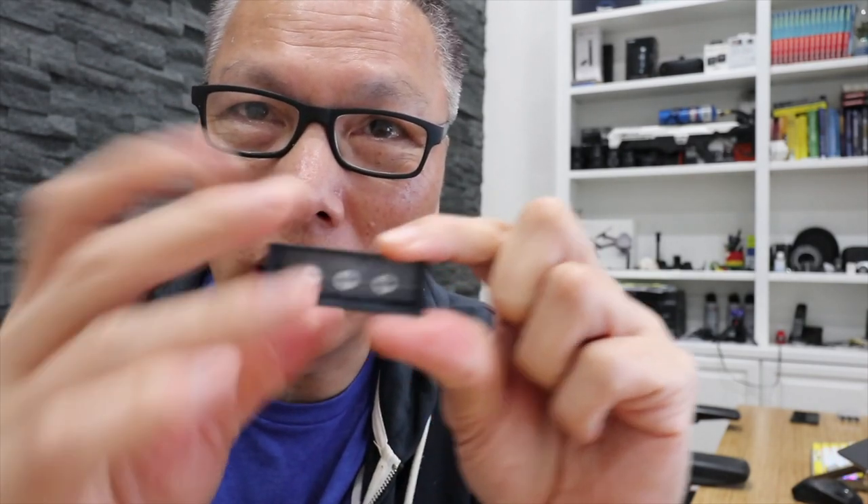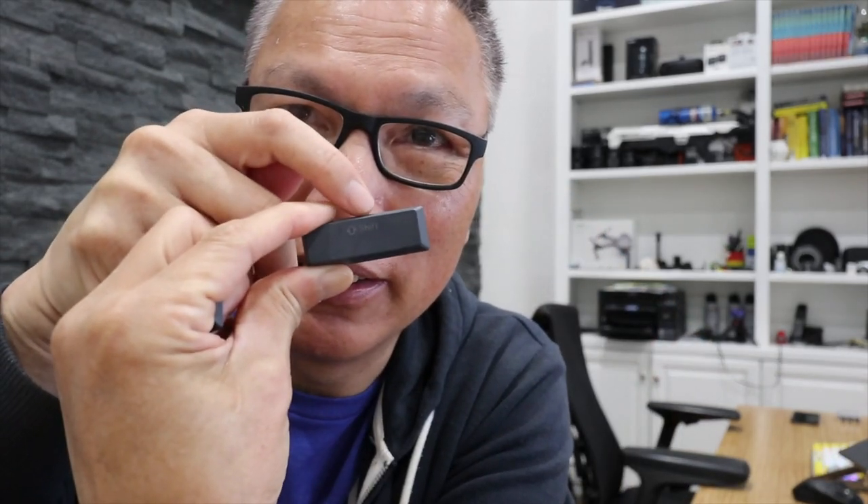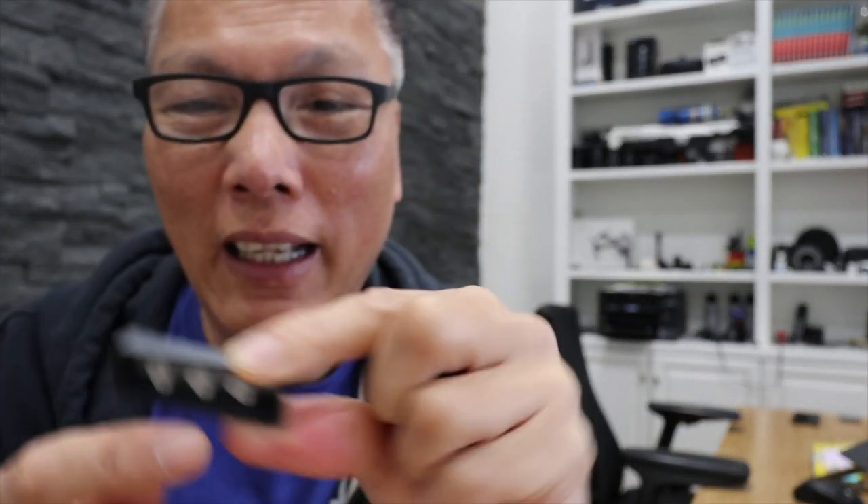The letters are made from a separate plastic on the inside — it's double-shot, basically plastic on plastic. This plastic forms the letter, so it will never rub off because it's plastic rubbing against plastic. That's double-shot PBT plastic — much more durable, but also much more expensive, and that's one of the reasons this keyboard costs over $200.